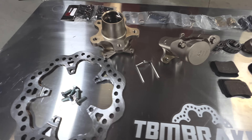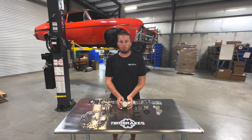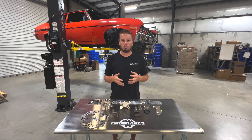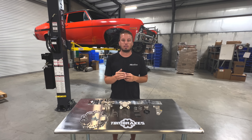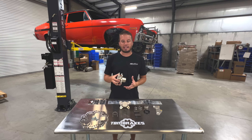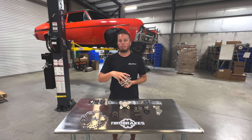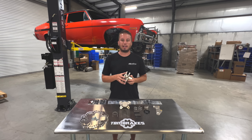This is just one half of the brake kit. We have our F1 two-piston caliper with a standard 1-3/4" bore piston. The unique thing about our front two-piston calipers is they're really the only ones on the market — especially for a spindle-mount wheel — with two pistons up front rather than one piston and one fixed pad. Also in our kit is a hub. The unique thing about our hubs is they do not have a hat; the rotor bolts directly to the hub, saving all the weight that would normally be in a steel or aluminum hat.